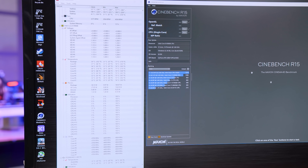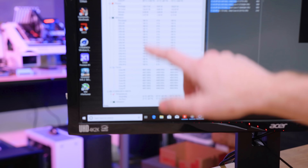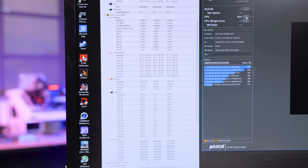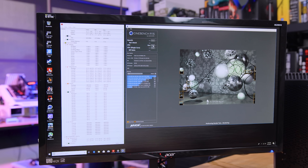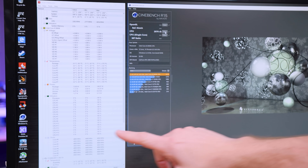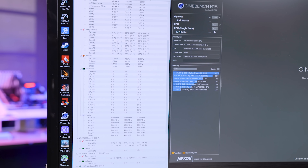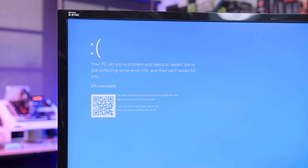Over in Cinebench — which will just roast those CPUs — when we run it, you can see the clocks stay at 4.8 to 4.81 GHz with temps sitting in the sixties, hottest core hitting 72°C. So we obviously have a lot of overclocking headroom. Our Cinebench score previous to this in the other video was around 1950 — this got us a 2070, simply because the cores are now locked. Locked at 5 GHz we scored 2,160. We tried for 5.1 GHz — we're going to call 5 GHz the feasible overclock on this, at least on this particular silicon. It could have just lost the lottery.